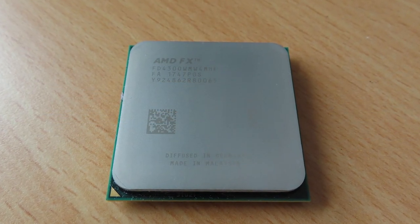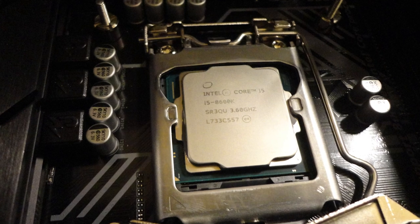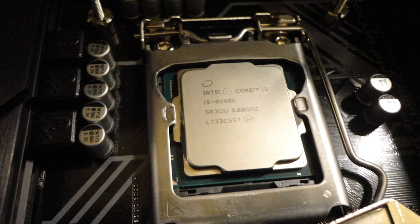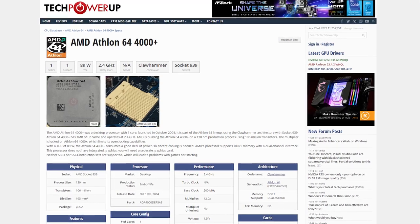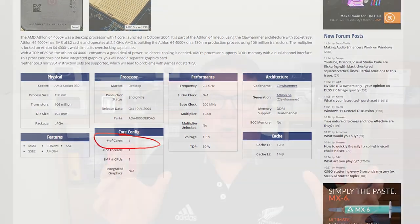The reason for this memory is about the same idea as using a sound card in the first place: to offload the CPU from its audio tasks. The idea behind the memory is that in games, smaller audio bits like gunshots, explosions, footsteps, etc. could be stored in the memory of the sound card when the game was being loaded. The advantage was that when gaming, the CPU could do other stuff and not be constantly busy transferring audio bits from main memory to the sound card, thus giving more frames per second.